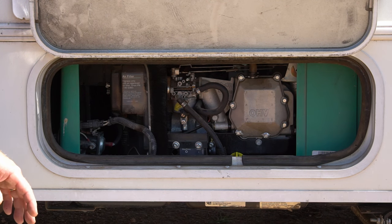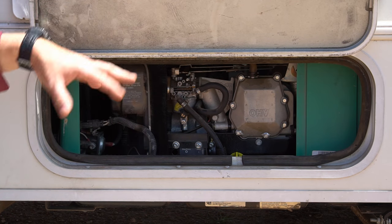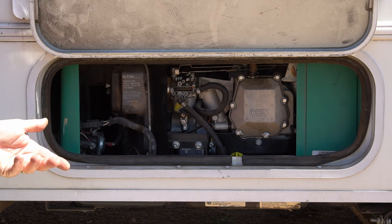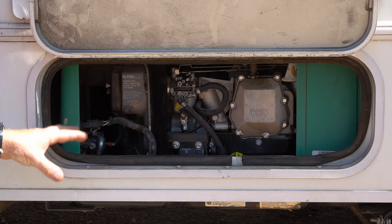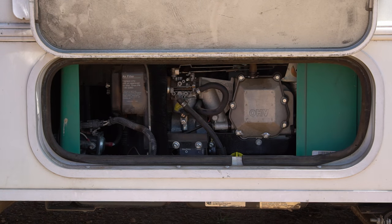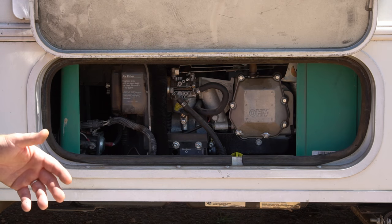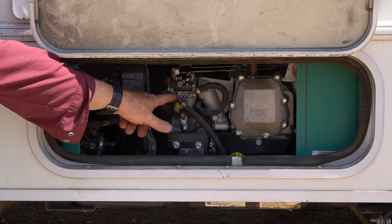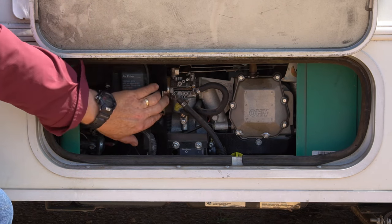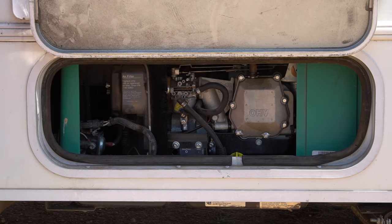This generator is not running good. The problem is that it cycles, revs up and goes down — it's not running smoothly. The reason is the carburetor is gunked up. The generator on the Minnie Winnie feeds its fuel off of the vehicle's gas tank, which might seem like a good idea. But these little carburetors really do not like ethanol gasoline. When the gasoline sits inside the bowl for a long time and separates, it can cause some gelling and clogging of the jets.